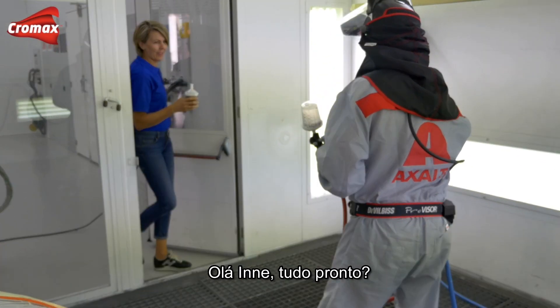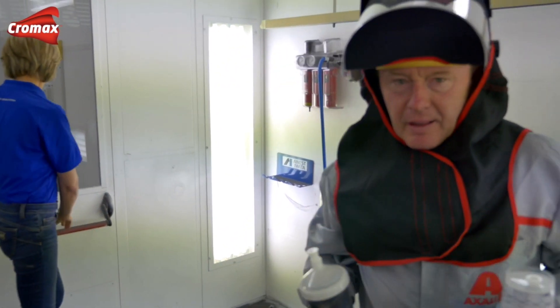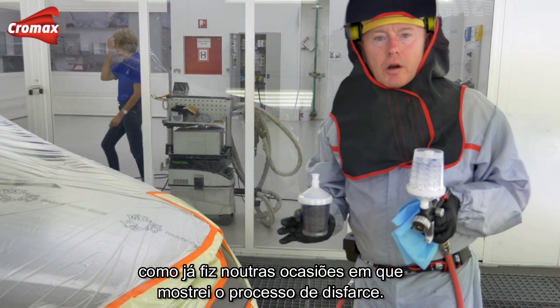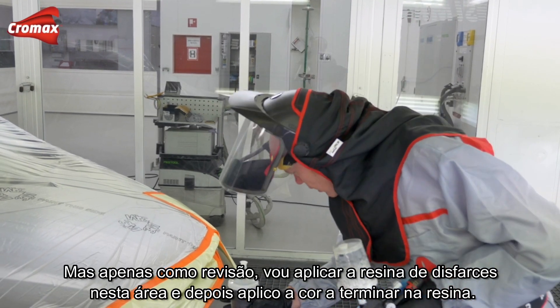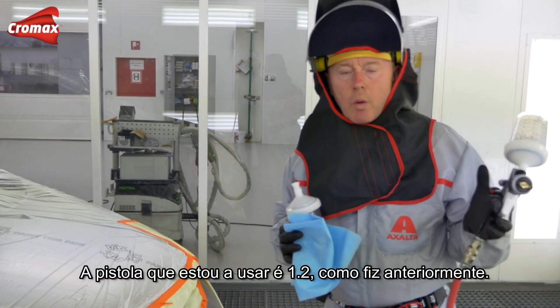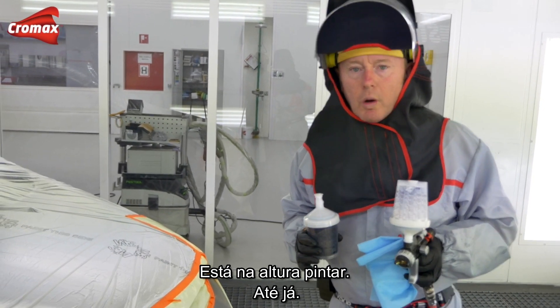Hi, is everything ready? Yeah, ready for use as you asked. Thank you very much. As you will see I have the two pots. As I've done on a number of occasions on our channel, I've already shown you the blending process, but just as a quick reminder I'll spray some blender out here, make my widest area first, then work back inside. The gun I'm using today is a 1.2 as I've done previously, so time to get the job painted and I'll see you in a short while.